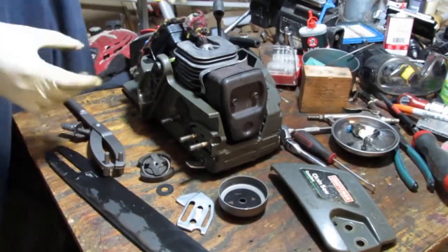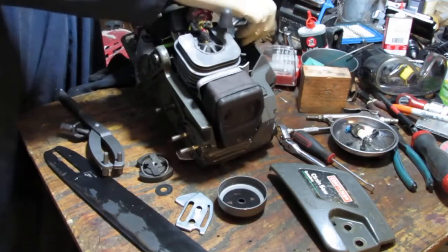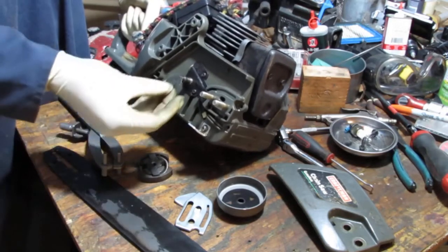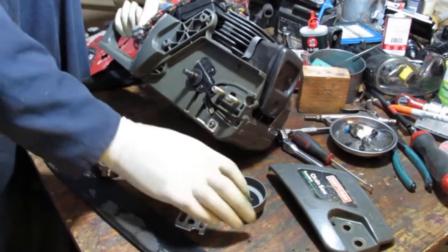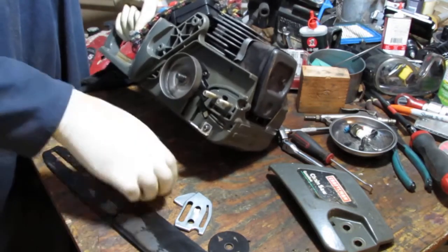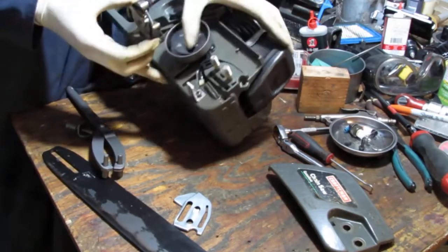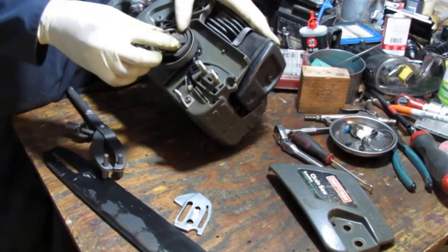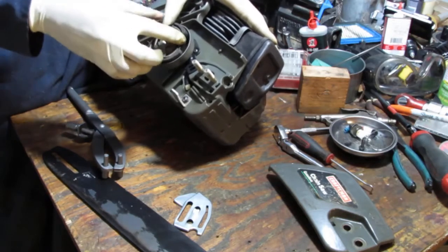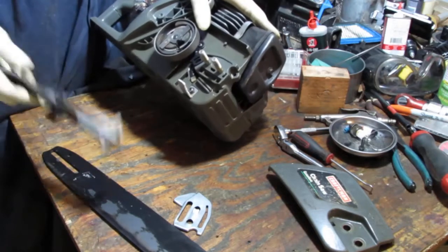So we gotta get this flywheel put back together. And I placed a rope inside of the cylinder to stop it from turning. So that's what it does. I'm gonna put a small washer on. That was there first. It goes on next. This bigger washer goes in between there. Now this is gonna follow an opposite pattern from righty tighty, lefty loosey because of the way the motor turns. So it tells you on here, there's no mystery why I know. Right, so this is reverse threaded. Get your tool.